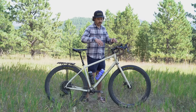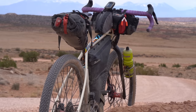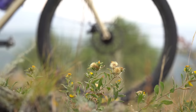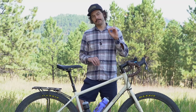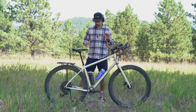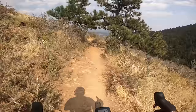This extra medium has a 382mm reach and a 630mm stack height, which is quite a bit. The bike rides and feels similar to the Kona Sutra ULTD, the Salsa Fargo, and even the Salsa Cutthroat. The top tube is 575mm, head tube angle is 69 degrees, chainstay is 450mm, and the bottom bracket drop is 63.5mm — very similar numbers to those bikes. The key difference is the slightly higher bottom bracket, which gives a bit more trail and stability over similar bikes, and also reduces pedal strikes — though it raises your center of gravity slightly.